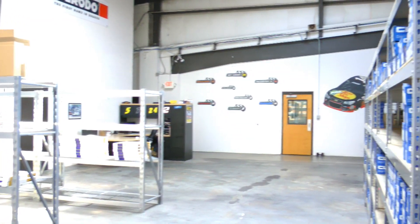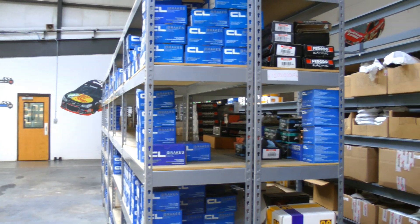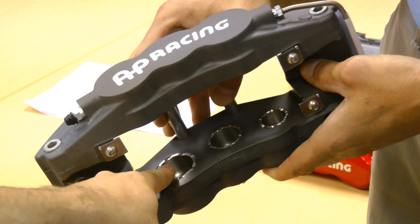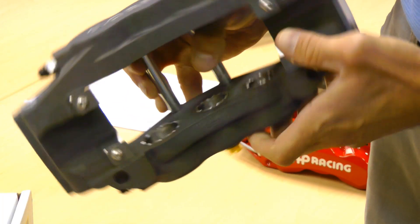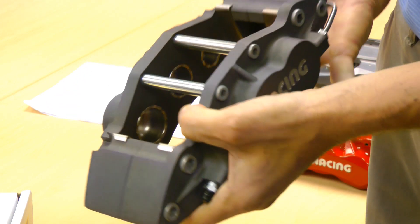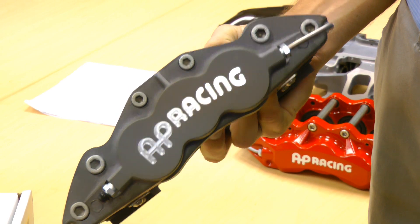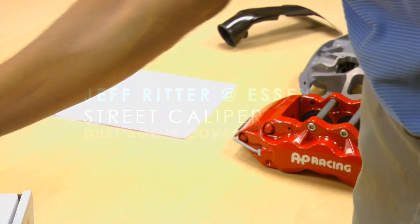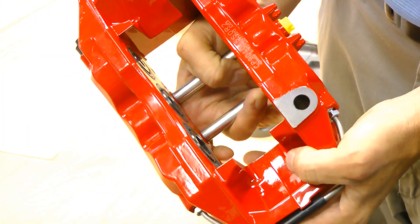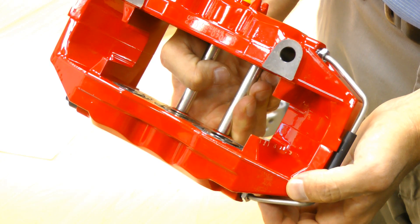One of the big things you always have to think about if you're going to go street or track is there are going to be some compromises, regardless of what product you buy. On the big brake kit side specifically, you run into issues like caliper finish. With something like this, you've got an anodized finish with the machined logo. An anodized finish isn't ideal for road salt contact — it just won't hold up as well. Whereas a painted or powder-coated caliper is going to hold up better.